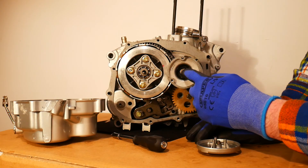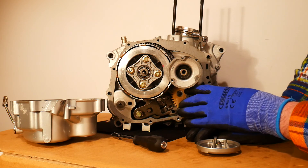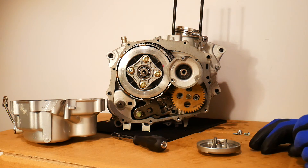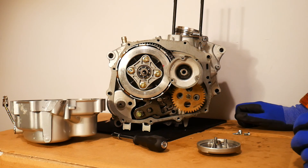The oil goes in through the crankshaft, flows through the motorcycle engine, and there you have your clean oil. That is just a quick demonstration of how a centrifugal oil filter works - hopefully you found this useful. Don't forget to hit like and subscribe to my channel, and I will have more content coming soon.